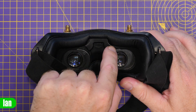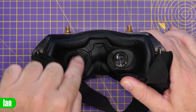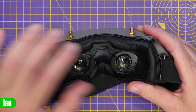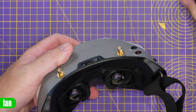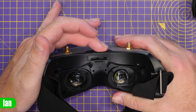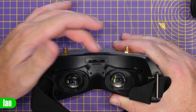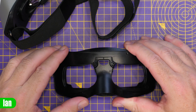When I got these goggles, the little foam pieces actually went a lot further up, and I did think they might be affecting the airflow, so I snipped them back a bit to see if it made any difference — but unfortunately it didn't. If we take the face mask off and pull it down, you can then see inside the actual duct piece. Moving it opens or blocks those holes — fully to the left allows the air through — and that is directed in this part of the mask down to each eyepiece.